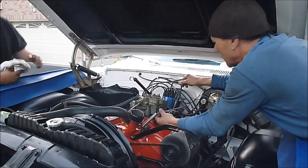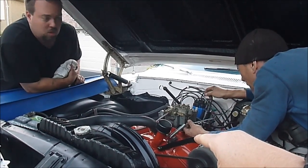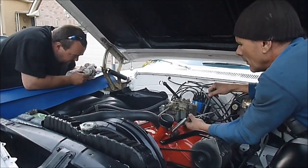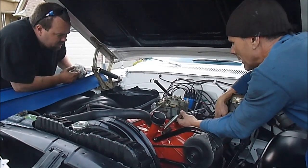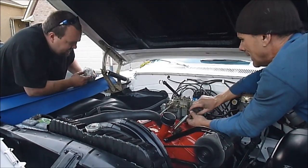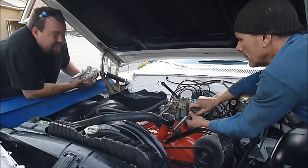What's smoking? It's just burning off. It's coming off the manifold — you spilled transmission fluid over here, right? Yeah, I think I did. It's just coming off the manifold because it's got nothing on it. It's the exhaust. It looks like it's coming off the physical manifold. You need a good three-quarters of fluid in there.